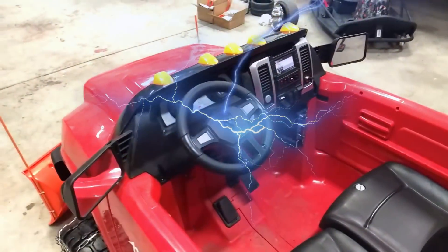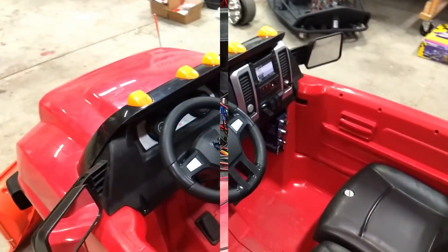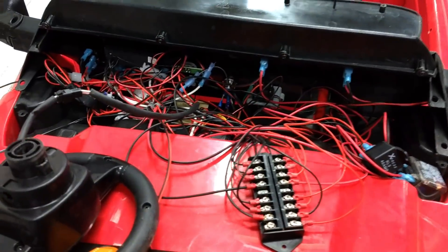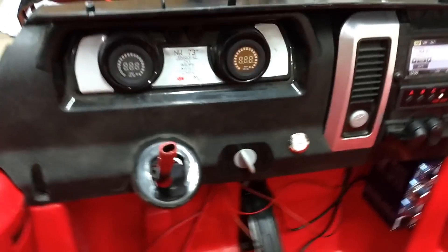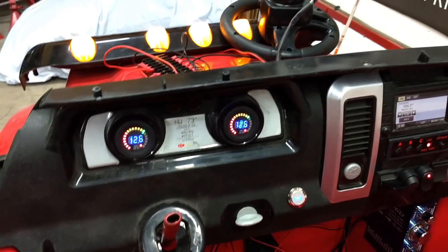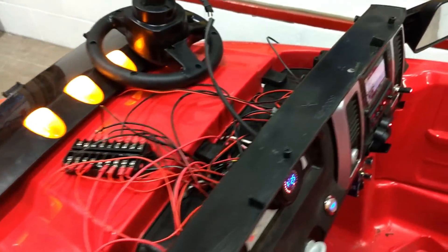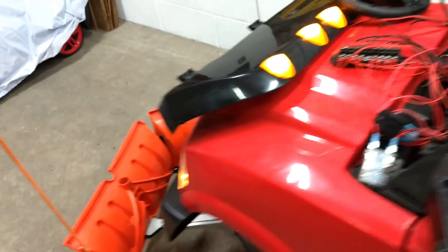Holy nightmare of an electronics job. This will probably be where I put some pictures of what it looks like under the dash. Here's what about 10 hours and an imagination will bring you. We've got dual voltmeters — one for each battery. They have to run on a relay so that they don't see each other. And of course we've got the plow — I don't know why I always say winch.